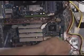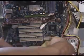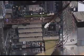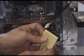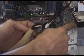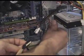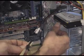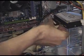There she goes. Right. That's IDE 0, and the black one goes into the hard drive. So again, move this out of the way. What you can do is put a screwdriver in there like that, and just hold that out of the way. Okay. So black one again. That red line, that's pin 1, and that is always the one nearest to the power connector. Hang on, you see that? That's the IDE connector strip there. Okay, that's the power, that's the jumper switches. The IDE pin 1 always is this side, next to the power, next to the jumpers. Yeah? So that goes in.